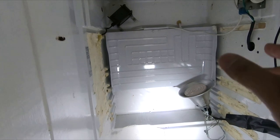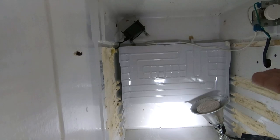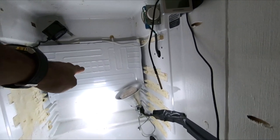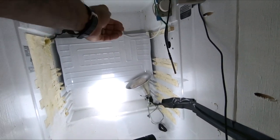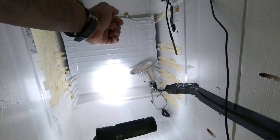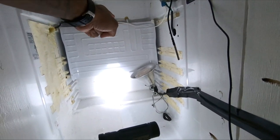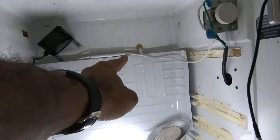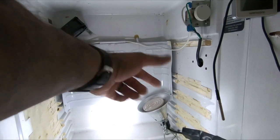You want to get a mini fridge that cools itself with basically a freezer section that comes out. Take the freezer section — it goes across here — and unscrew it from the sides. Then real, real gently you're going to bend the whole thing down flat. What that does is it gets it out of the way and allows you to use the space in here. But that connection right up at the top, be very careful: when you're bending this down, if that kinks, cracks, or you get a hole in it, the fridge is dead.